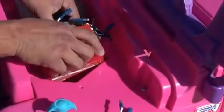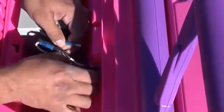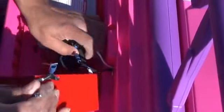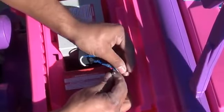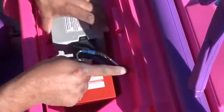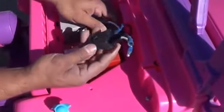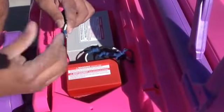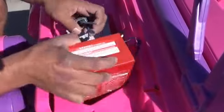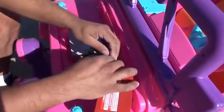I grab the 6 volt, same thing to the negative and positive. What that helps to do is — when you hook up both batteries — you hook up your positive to the positive on the 12 volt, and you're basically just jumping two batteries. Then you hook up your negative from this battery to the positive on this battery — that's making these two batteries jump together. Then you got your negative to your negative, so all it does is go across and back into the car. Then you have this here, and the reason you have this left is for your charger. When you've got your 6 volt charger in your house, you connect that to the charger, and this goes onto the other two wires on the battery. So this goes to the battery like this, back onto the battery, and then this goes to the other charger — that's only when you want to charge it.